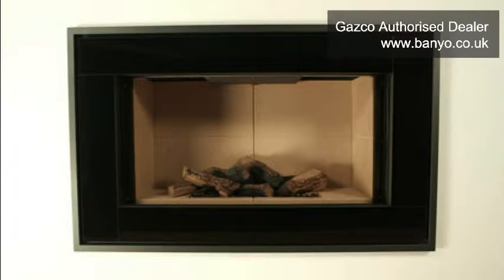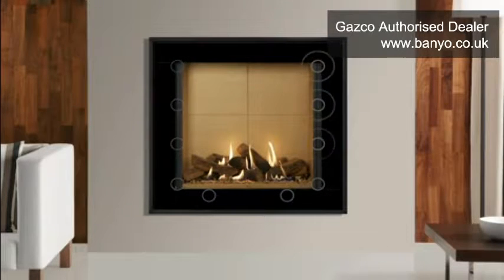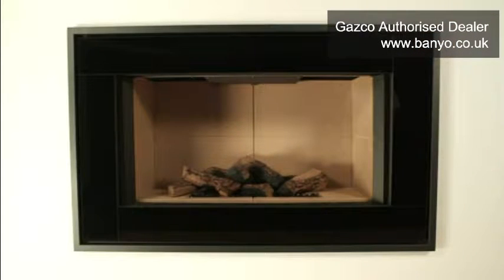To clarify, the Riva 2 1050 has 9 screws and the Riva 2800 has 10 screws. If any of the screws are missing, please do not use your appliance and contact your local retailer for advice. It is now possible to return the slotted trim to its place at the base of your fire, just in front of the glass, followed by the two magnetic side trims.